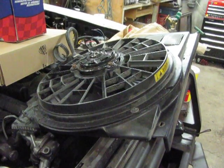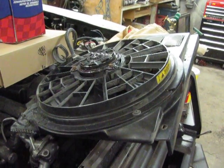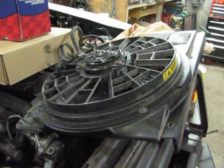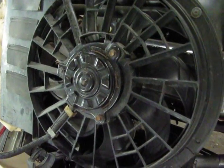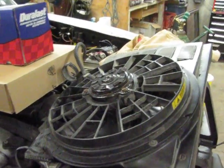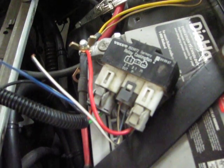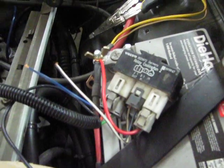This is a fan out of a 1992 Volvo 740 wagon. I noticed instantly how narrow it is, yet the strong similarities it has to the famous Ford Taurus fan that a lot of people are using in various vehicles because it's so powerful. I also noticed that it came with a controller and relay, so if you can find a simple on-off switch, it would be very easy to wire this versus the traditional Ford Taurus fan.